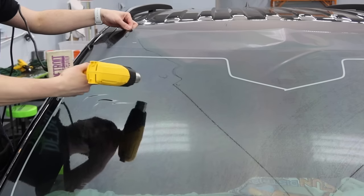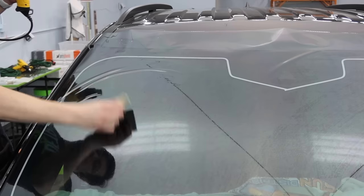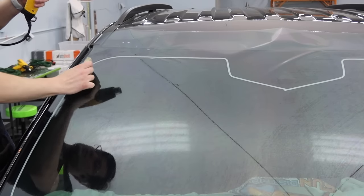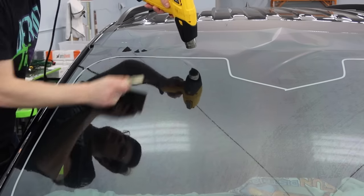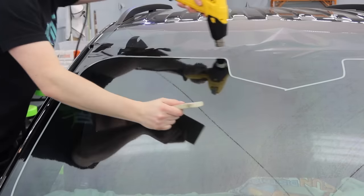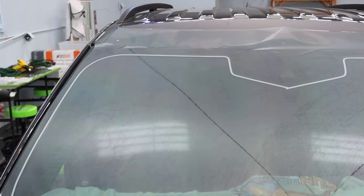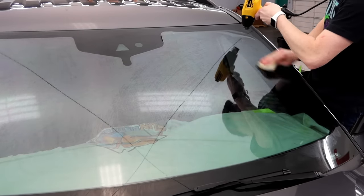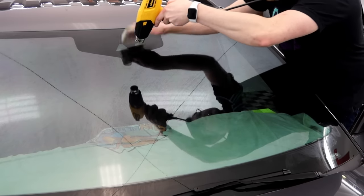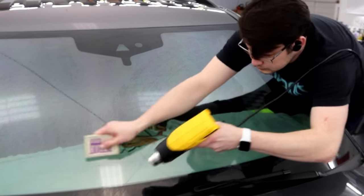I just end up pull-shrinking it here — lift the film, heat it up, and those tension lines start to look a little pronounced and tight. If those lines are over-shrunk you're going to have a hard time getting the film to lay down. This was shrunk just enough — probably borderline too much — but with a little bit of pressure you can get it to lay down; it's not a big deal. This comes with time and practice. Don't be frustrated when practicing shrinking — you can do this on the same window dozens of times and it'll come with practice. After I cut it, I also make sure all my edges are touched up, so I do a rough shrink, make sure everything is set, cut it, and then polish up all my edges. There you go — thanks.